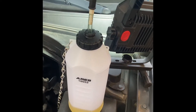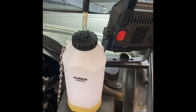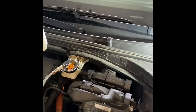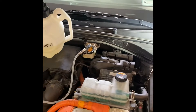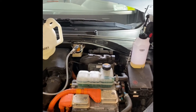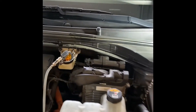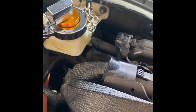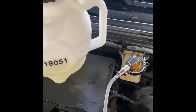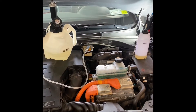It's not even necessary because I'm just pressurizing and going to be filling that bottle with the fluid. I'm going to go right rear, left rear, right front, left front — keeping an eye on the level, making sure the reservoir stays full, which it should. I have two quarts of fluid in there, so that's plenty. And that is the brake fluid flush.